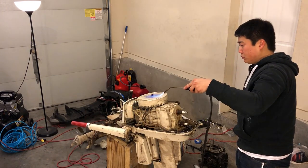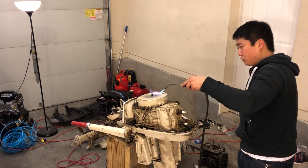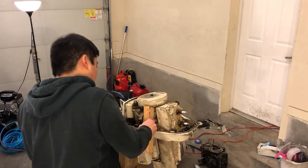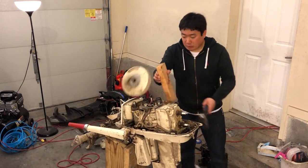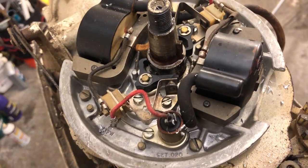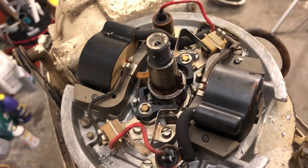Quick update — the puller stripped out the aluminum threads, it is stuck on there so hard. Weirdly clean under there. Makes me want to look in the cylinders before I start tearing it apart. So here's a look inside the cylinders. Things look pretty rusted up — it doesn't look like something that I'm going to get free by just rocking the engine back and forth.